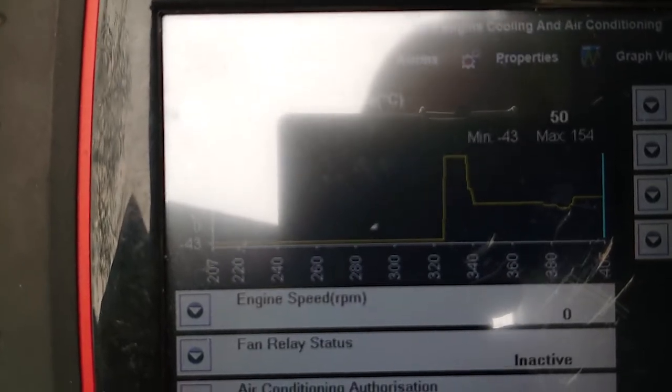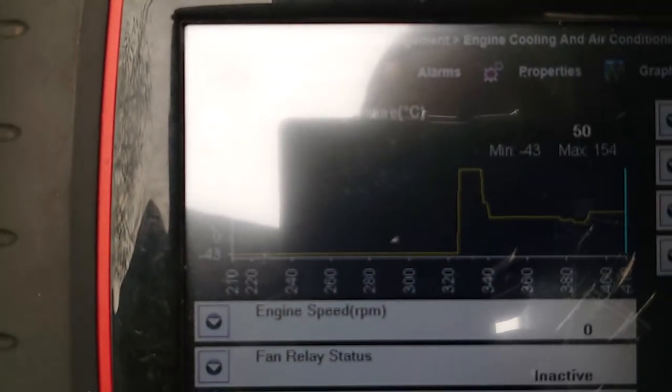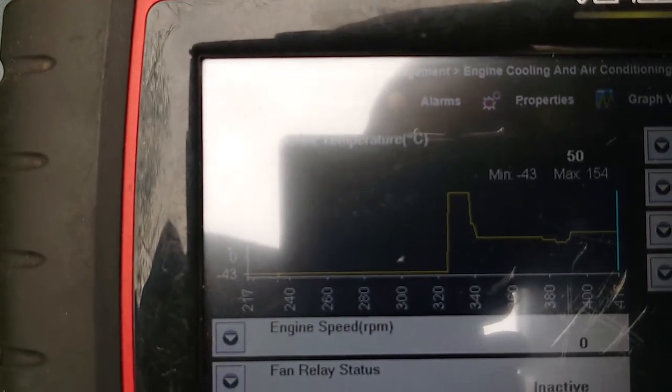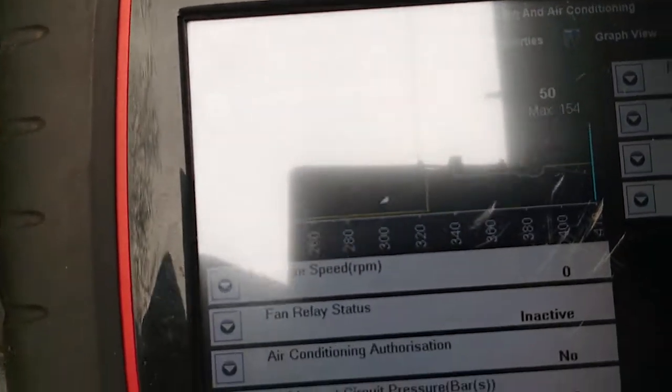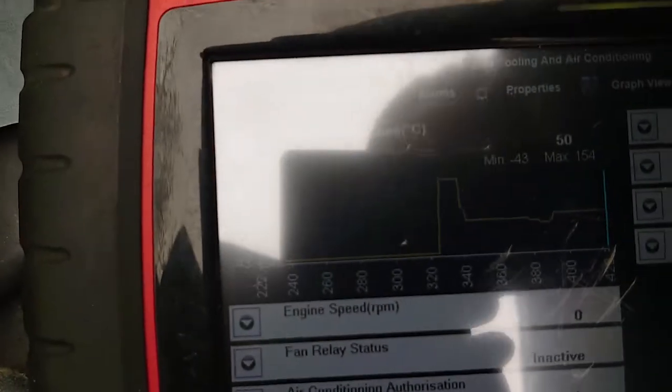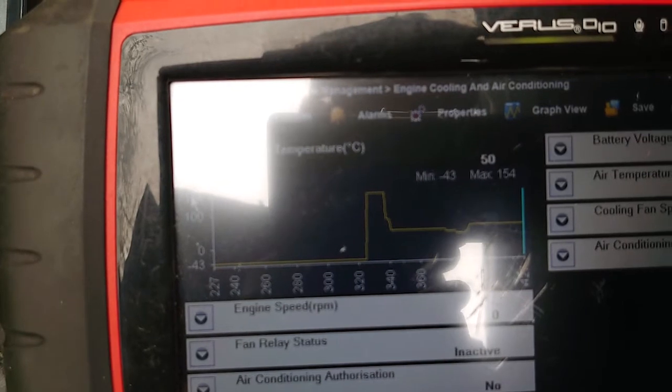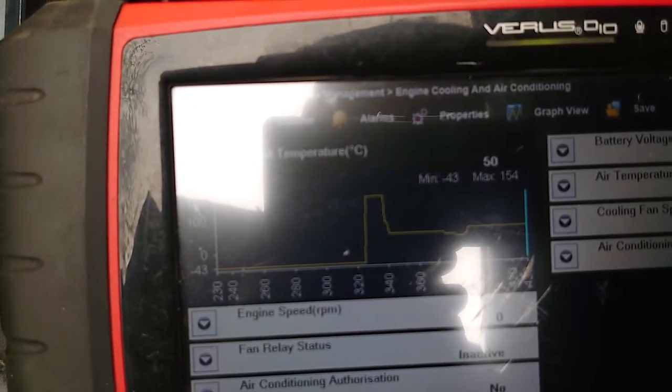We can be fairly happy that all the wiring's intact, the ECU responds, and I would be putting a temperature sensor in there if that was the suspected fault. That's a pretty good test — it's my preferred method most of the time, as long as it's accessible.